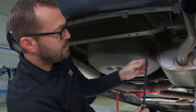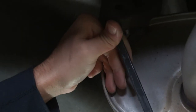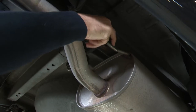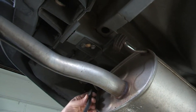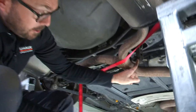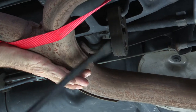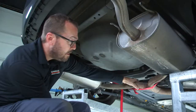I'm going to remove the rubber exhaust hangers using a long pry bar. With the four exhaust hangers off of our mufflers, there's one more to do, and that's right here in front of this junction here. Now our exhaust is loose and hanging from that support strap.